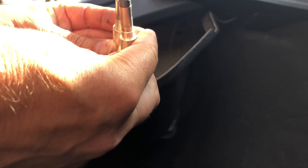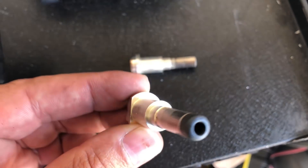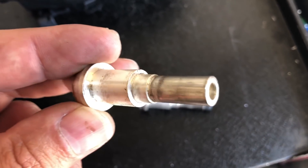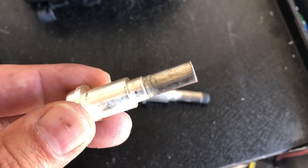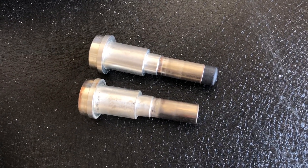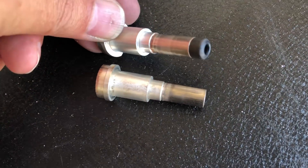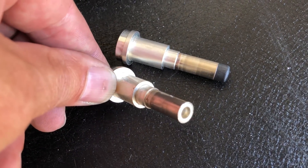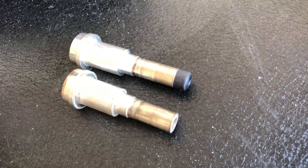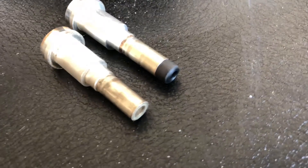Gonna replace that with a new one, just the top part. This is the new one with the black top piece, and that's the one that was in my charge port. It looks fine otherwise — a little worn, but that's just normal. That's why the technician said there's no problem with the actual electrical connection, because the metal part of the pin is not compromised. It's just the black plastic tip. I think it's kind of important because if you insert the plug without that black piece, the pins from the connector go over this hard edge, and I'm not sure if that's so good. This black piece adds a little bit of guidance.